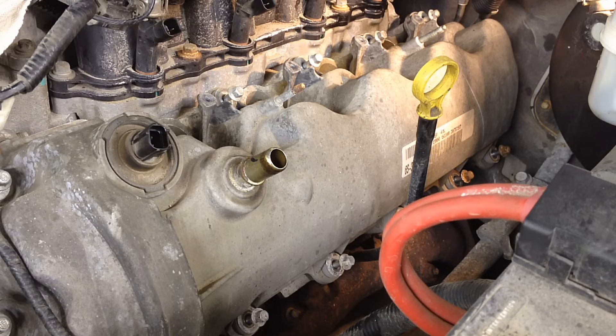In this video I'll walk you right through it. There are a few minor differences between the 4.6 and 5.4 — mainly in the number of bolts and the valve cover depending on early and late builds, and of course the torque sequence. All that information will be in the description below, along with the new updated VCT solenoids from Ford. I only use Ford VCT solenoids — those will be linked in the description so you can just click and order them.